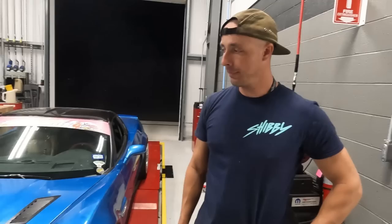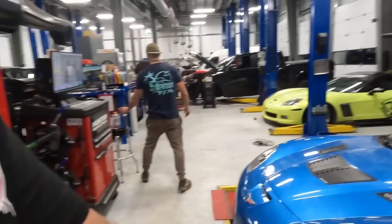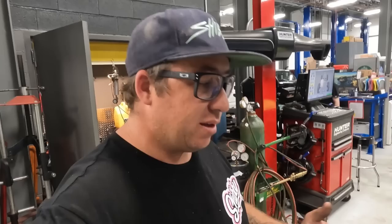So Luke and I both set ours up to roughly 5 degrees, but with the shims in the top of those arms, it's gonna pull it out to three degrees both sides. If even less, yeah. Hopefully less, especially if it's half inch, that's huge. So that's why my fitment isn't perfect on the front yet. I'm a bit of a fitment fanatic, so I want it to have good fitment. It doesn't quite yet, but we will get it sorted.